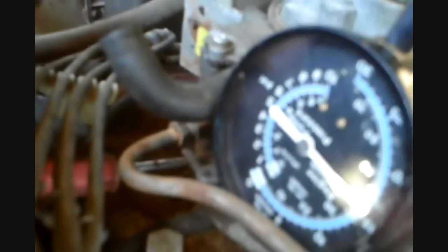This is how you know your power valve is closed — it's not dumping unmetered gas into the carburetor while it's running. You're able to get the engine to stall out by turning the idle mixture screws. Turn it in and you're starving the gas to the carburetor, engine wants to stall. That's how you know your power valve is closed at idle and it's not dumping gas through the main jets.